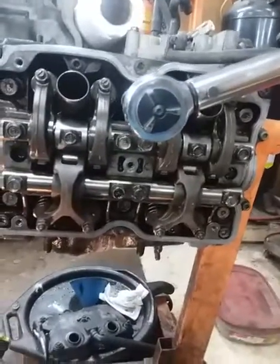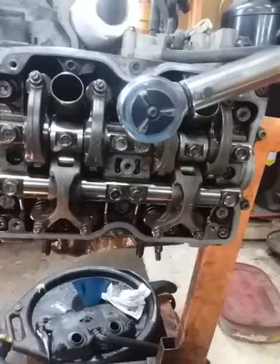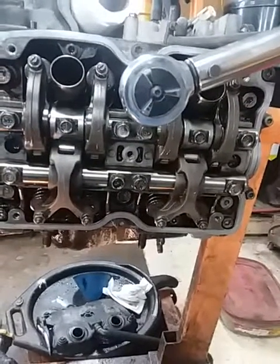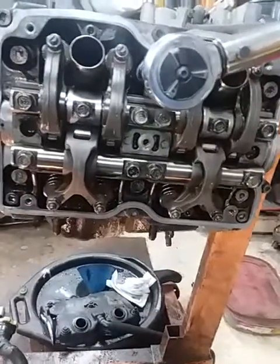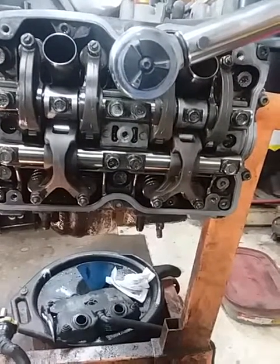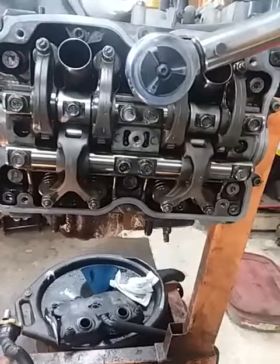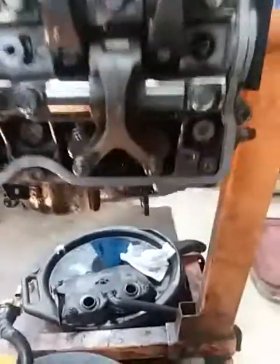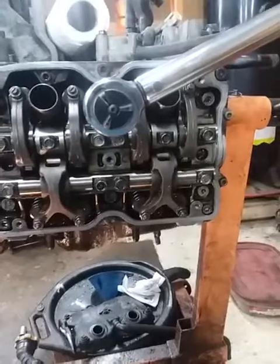Now I'm going to set this thing at 30. Okay, 30 foot-pounds, and then we'll go to 45, and we're going to do 10-pound increments after that. You can do it however you want, but 10-pound increments is what we do. The reason I'm going to hit 45 next is because I need to be at 85 at the end, and I don't want to do 5-pound increments at the very end. I want to do a 10-pound. So we're going to basically snug it. You can go to 35 if you wanted, whatever.